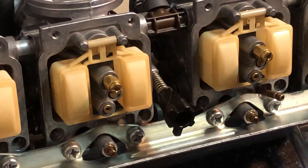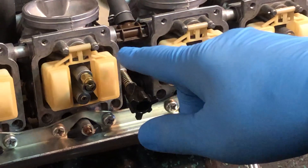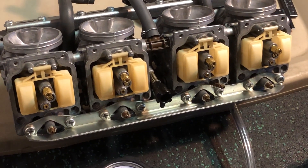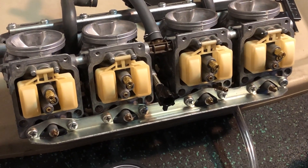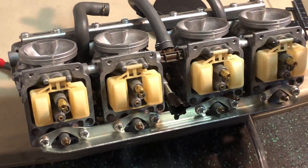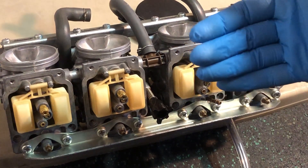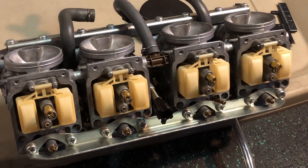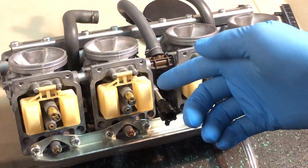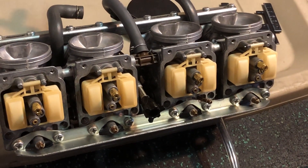That's interesting — what does this really mean? It means that this carburetor will be running leaner than the other three in operation, and that's not a good thing. I would certainly be checking all these needles, if I had a bunch of them, to make sure that all the float levels are the same. I would have adjusted the float level, but in this particular case the float level cannot be adjusted. By definition, this carb is going to be running leaner. If you wanted to make sure they're all running the same, you'd have to get a different needle.